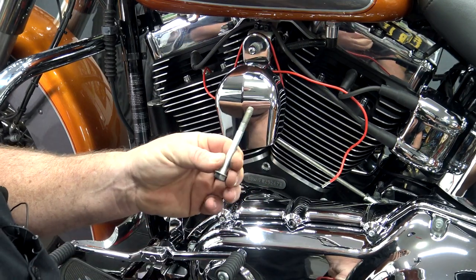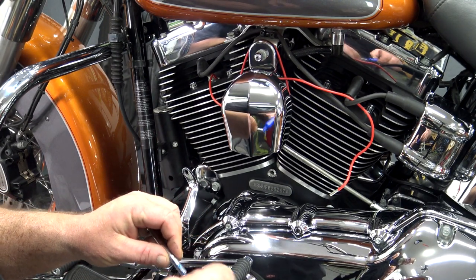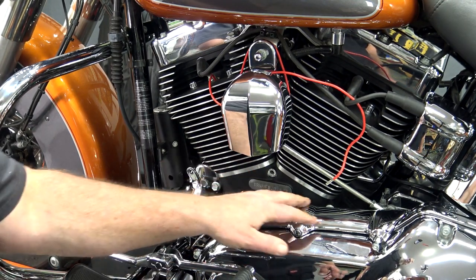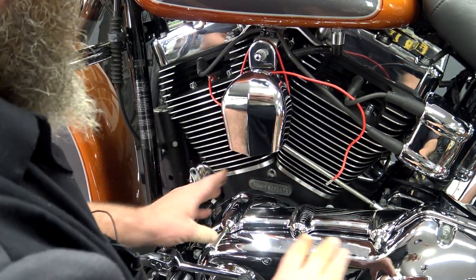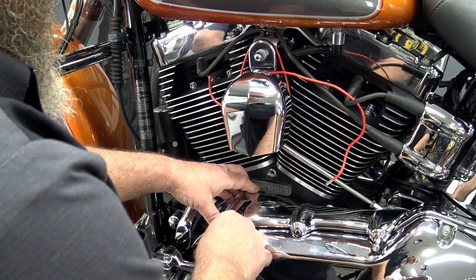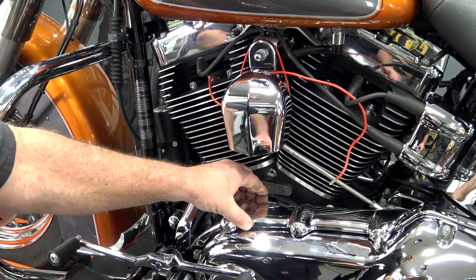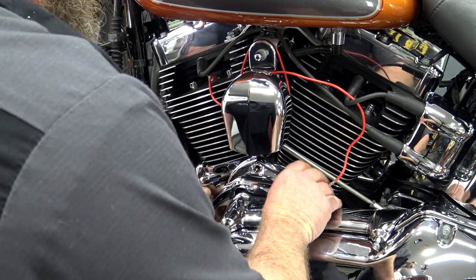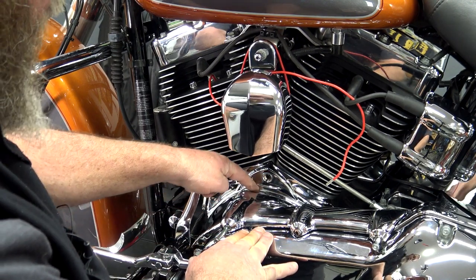We're going to pull that bolt out of there. So this is the 103, so we're going to use the three and a quarter inch bolt. We're going to dab a tiny bit of blue Loctite on this. Now, one thing I want to mention: if you have the inner primary cover like I do, you can see that I backed these screws out and pulled this out. You don't have to take it completely off the bike, but the cylinder base cover sets behind the inner primary cover. So just simply loosen these bolts and kind of pull this out — this is two pieces, split right here. Now that you have this pulled out, you can take your cylinder base cover and slide it in and get that into place just like that.